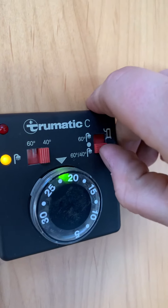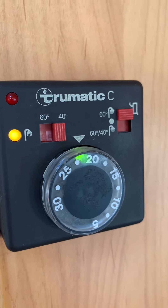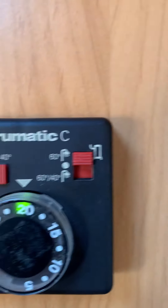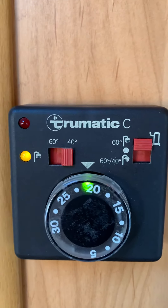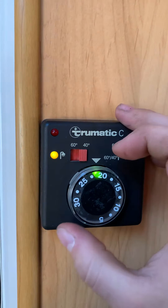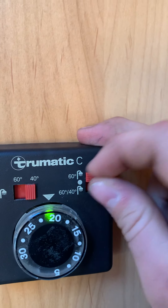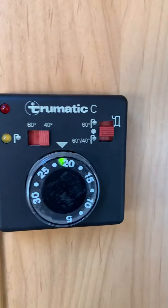If you want to use your heating, go all the way up to the top — that's where this temperature dial here actually comes into its own, and that's where it will get to its desired temperature. The little heating symbol means heating in the Truma world. The temperature controls the room temperature, and up is for both heating and hot water, down is for just hot water. The fan for the heating will run on its own — you don't need to do anything else. Back to the middle is all off.